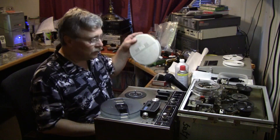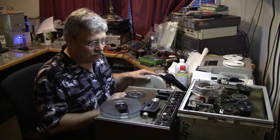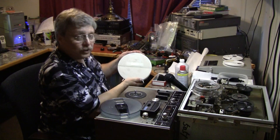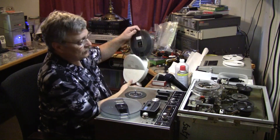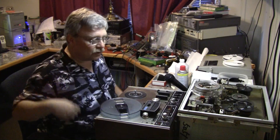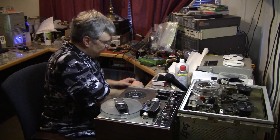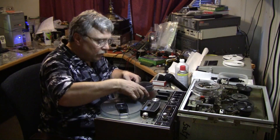What I'm going to do is clean this tape using my Akai 4000D audio tape deck as just a spooling engine. This is the old-style box that CV2000 tapes originally came in. There's no guarantee that the tape you find in a box like this today is still a CV2000 recording, because there were many videotape recorders that used the same tapes but recorded in different formats. So I'm using the Paul Beck method of cleaning.